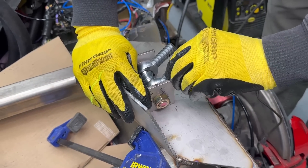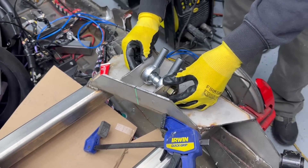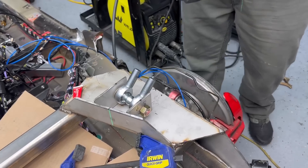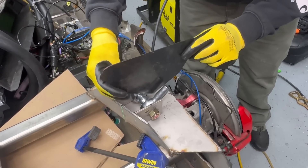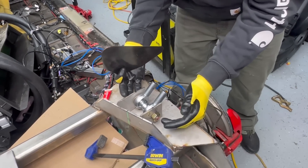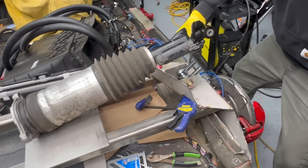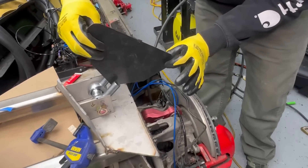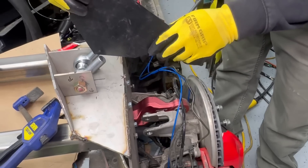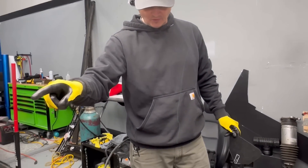Usually you'd see one of these setups on off-road trucks, but you want to do two because there's a lot of force here. Let's call this the cantilever arm — it plays like this. This is where the most force of the suspension will be. This standing like this gets bolted in here, then there's an arm going down to here — that's my setup. I'll tack these in, get them both ready, then I need to cut these out — I've already drilled them.